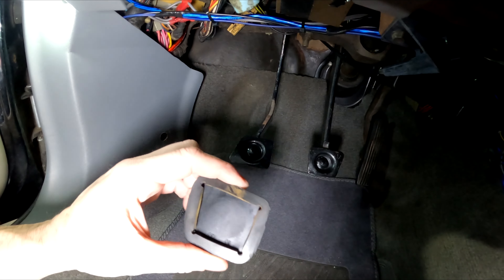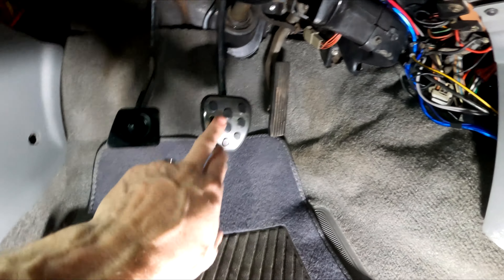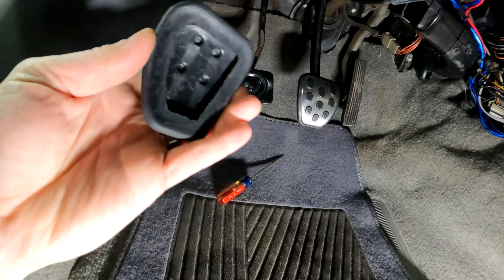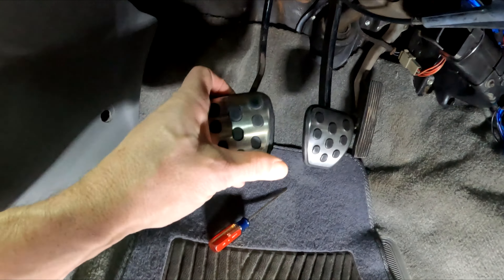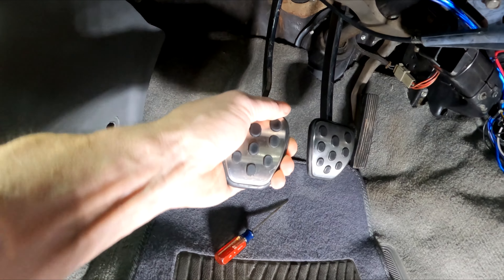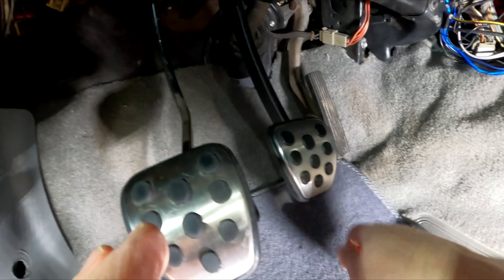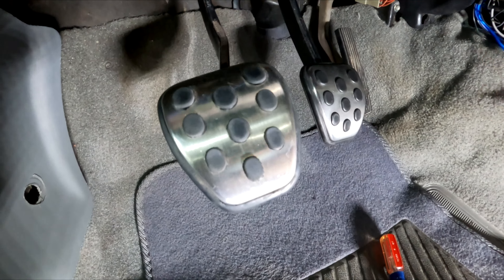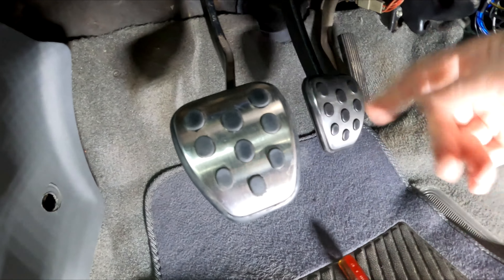So I'm going to go get my other ones and see if we can make them fit. The brake pedal went on pretty straightforward. What I like to do — you see how the back of this has the rubber folded over so it fits in there tight — is come in here and get this side on first, pull it down real tight, hold it at an angle and then turn it over. While you're doing that, take a little flat screwdriver, stick it in between the metal and this and literally just pry it over — you'll have to massage it, work it. It helps to put a heat gun on it to soften up the rubber. Some people put soap and water to make it slippery, but I've found just by heating it up a little bit and using the screwdriver to pull it over, it goes right on.